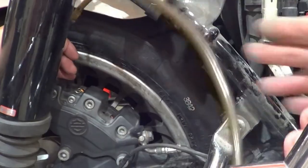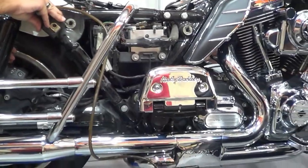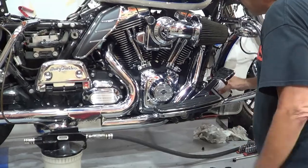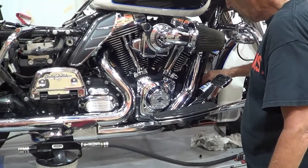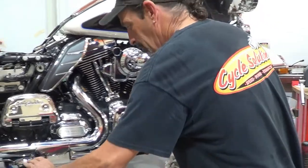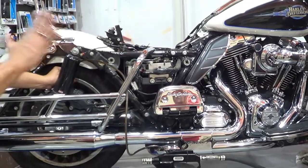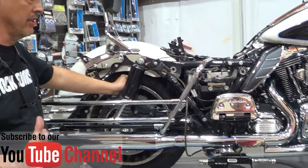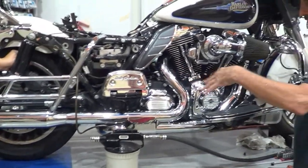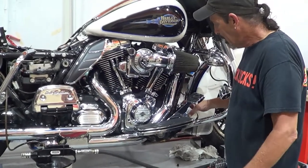Like so — hold it to make sure we don't spill. And then of course we use brand new brake fluid out of an unopened container — I've already opened this container just for this video. Then we're gonna fill it to the top and turn our bleeder on. Something important to know while you're doing this: this bike is not turned on. Do not turn the ignition on while you're doing this job. That's gonna slowly pull the fluid out to the back of your caliper, and you just want to keep it full.